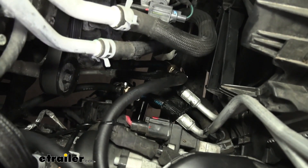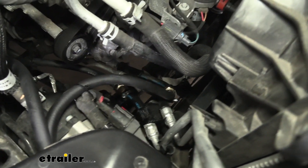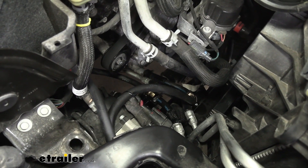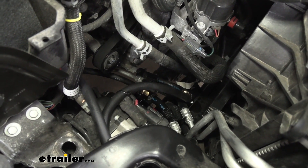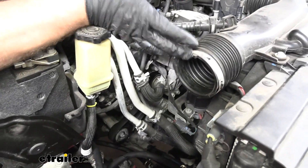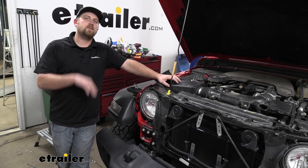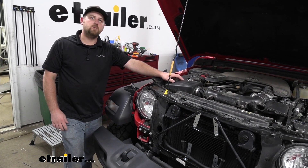Now we can focus on getting our airbox back in place. I went ahead and zip-tied the upper lines just to keep them out of the way from any hot, moving, or sharp parts so they're not bouncing around and getting damaged. Before putting the airbox back, I think it would be useful to start the vehicle up now and check for any leaks while we can still see the connections. It is okay to start this particular Jeep with the airbox off — this is the 3.6 liter and the mass airflow sensor is incorporated further downstream. The only thing to watch out for is that the air tube is exposed, so you don't want any rags around that could get sucked into the motor. As long as you're in a clean environment, this is fine to do for a few minutes and won't cause any harm. Once you've let the Jeep run and verified there are no leaks, go ahead and reinstall your airbox the opposite way we removed it.